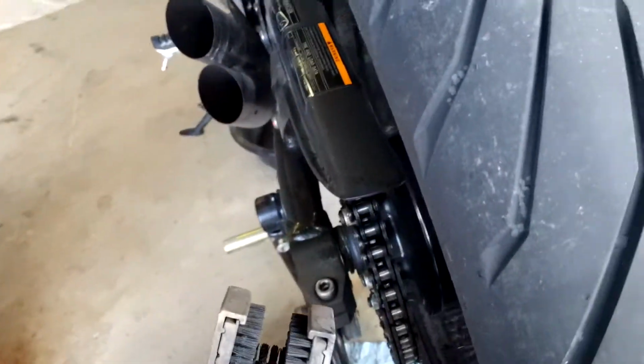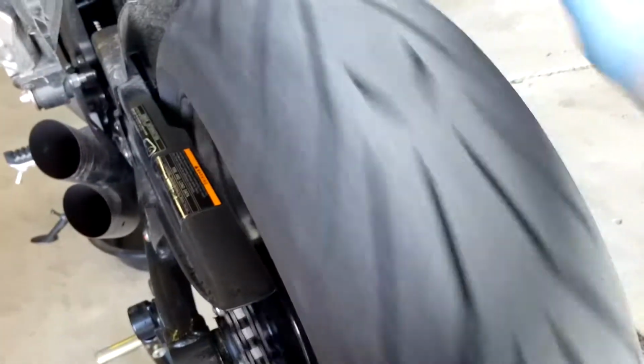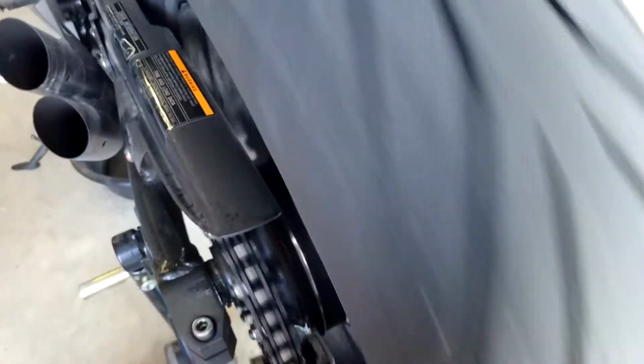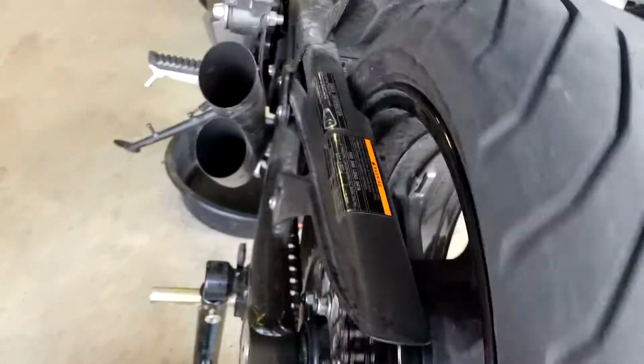So, grunge brush, use it this way, like that, or rip them teeth in there, roll that tire. As you can see, I think I got some drip in my pan already up front. It's just from experience, dealing with this bike, dealing with other bikes, cleaning my chain. So the grunge brush, of course, knocks all of the harder sediment stuff that I've got in my chain out. Just loosens it up real nice, and I go the opposite direction as well. Kind of like brushing teeth, up and down, left to right.